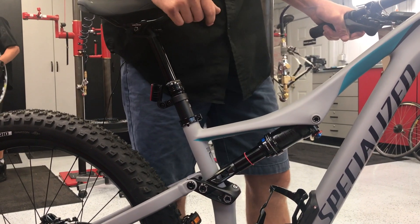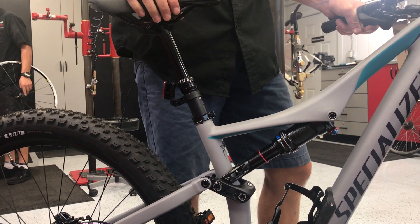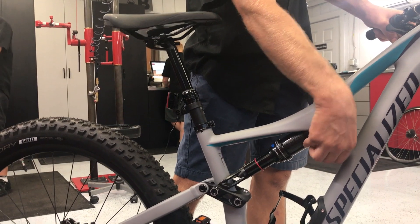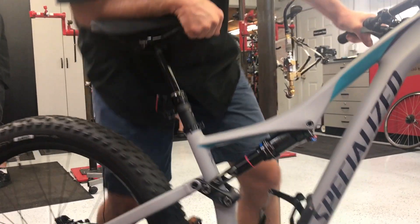Generally when it's this slow, you'd be riding on a really smooth trail that doesn't have a lot of bumps or impact — you'd be sitting right down in the sweet spot. When you're on a really chudery or super rough trail, you'd want to speed this up so the shock has time to react to the next bump.